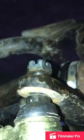So you're gonna want to go ahead and loosen all this up. You'll see it. Those are your bolts. This one's still got a little pressure on it. On your tie rod, you can see that little groove right here. Sometimes this nut won't come off. You can stick a wrench right in here. It's probably metric. I didn't have a metric wrench next to me, so I just grabbed a 9/16 wrench and stuck that in there, and it fit pretty snug, and I was able to get it off.